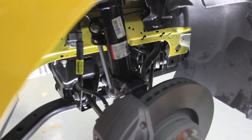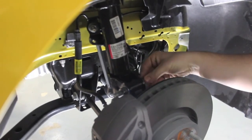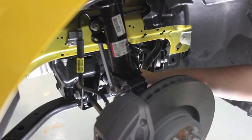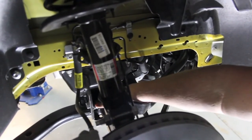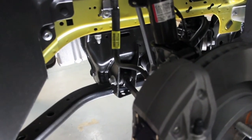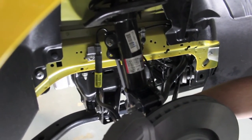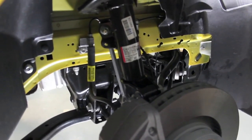You can see a little bit more into the front suspension with the tire pulled off. You can see the front strut here. Camber is not adjustable like on some cars — there's no eccentric here. You'd need a camber plate on an aftermarket coilover if you want to do that. You can see the front end links which have ball joints on them — they're not like a rubber bushing, so they're really durable over time. You can also see a little bit into the front pillow ball joint for the lateral link. For cars without the performance package, you're not going to have this joint here — it's going to be a rounded control arm with a rubber bushing in the middle. For you guys that want to upgrade that, this would be a nice, cheap, cost-effective upgrade to the lateral link off the performance package car. It'll probably give you a little bit better steering feel and cornering control.